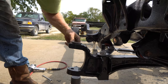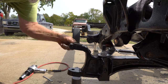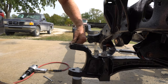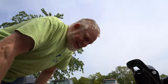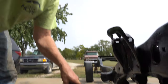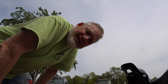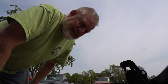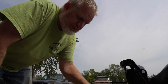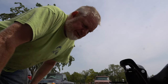I'd like to get them nice and clean so that if you have to exchange them to change your alignment, it's not a hard job. I've coated it with anti-seize and we'll just tap it in. When you tap it in, you've got to line up the bolt hole with what you're doing over here — it's a simple tap, it don't take much. What I do when I take these things apart, I take a punch — a letter punch — and mark 'passenger' on this side and 'driver' on that side, so when I reassemble I don't get in trouble. I've got this marked so I know which side is which because the other side is a straight bushing and this one's definitely offset. We'll take it in and get it aligned, because we don't know how much that was throwing off the alignment.